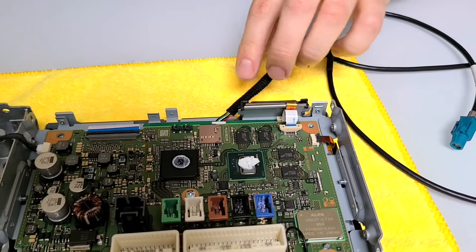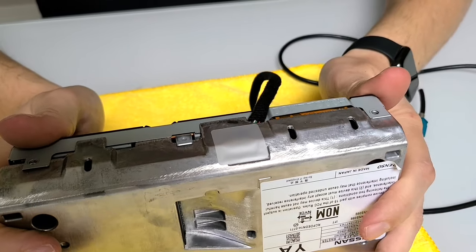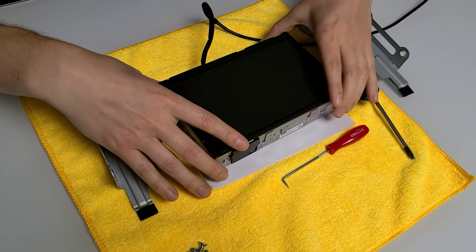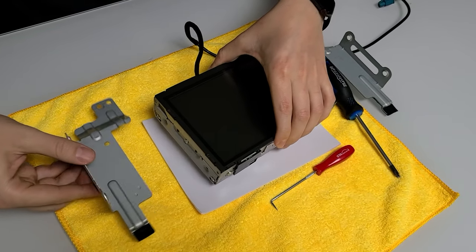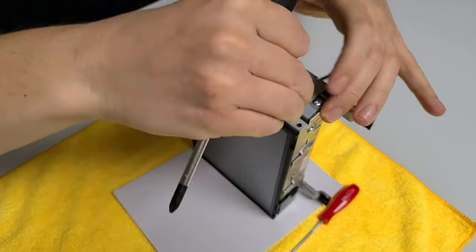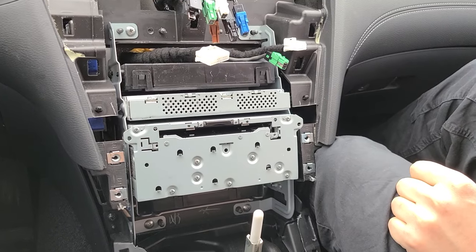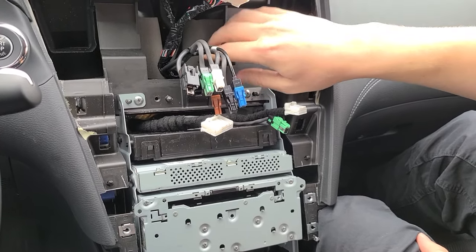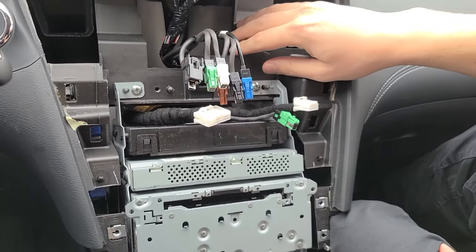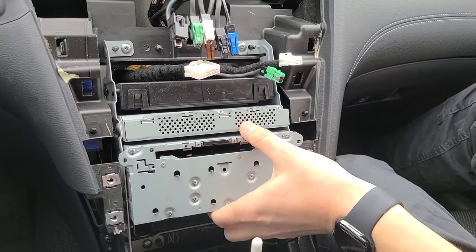Move the cable a little bit to the side, and next we're going to close the radio with its original back — be careful not to squeeze the wire or damage it. Once everything is in place, put all the bolts back around the stereo and at the back. The last step is to attach the brackets back onto the stereo. At this point, the radio looks exactly as original, but you now have an extra cable for the video signal that will connect to our module. Our goal is to install the screen back, running the extra wire behind the main radio portion, down and out in the middle. That's going to be one video cable, one harness for the module, and the microphone. To place the microphone, we have to remove this center radio piece — it's held on by four bolts, two on top and two on the bottom.